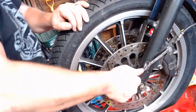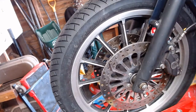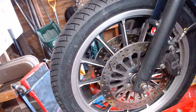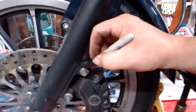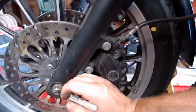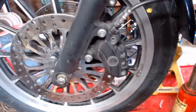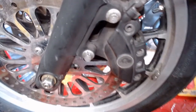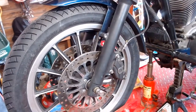Before we get done here, one more thing I like to do to my bolts — that way I can walk around and check that everything's good at gas stops, rest stations, or in the morning. I take a little black magic marker and put a dot on each bolt at 12 o'clock. It's a very subtle thing, but the idea is these are important bolts — they're your front brakes. If I do a walk-around and any of these dots are at a different location other than 12 o'clock, that bolt's backing out and I've got problems I need to address ASAP.